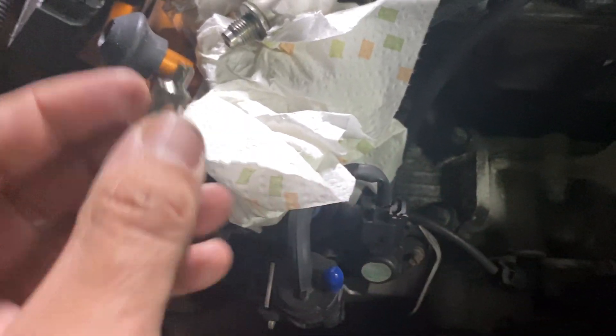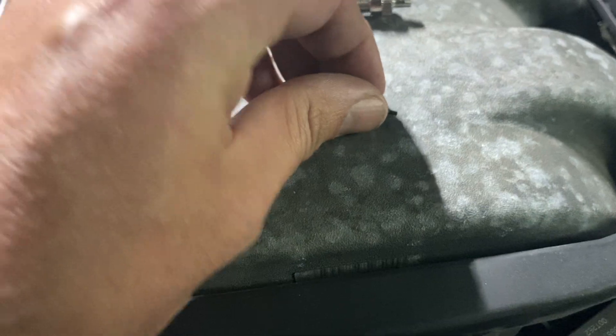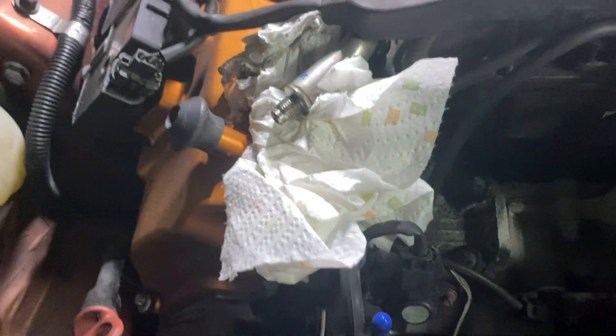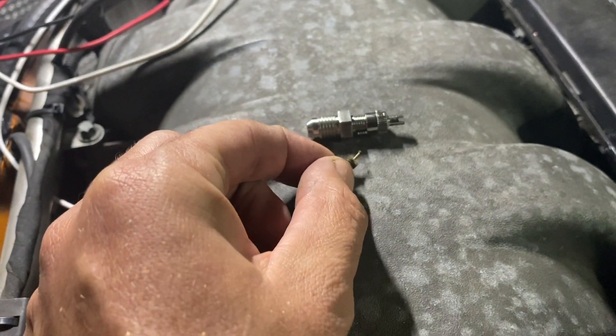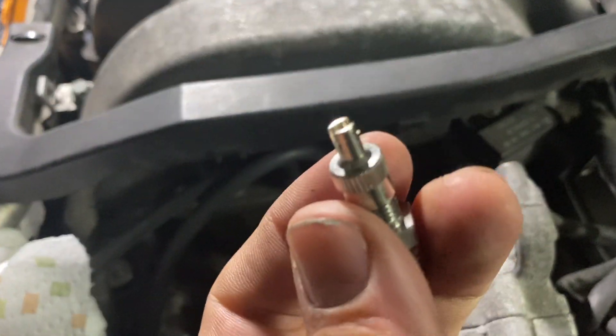Probably should've filmed this but no biggie — the Zex kit comes with this tiny little tool that's meant to take out Schrader valves. I put it on one of their fittings to give me a little more leverage. With the Mercedes fuel rail, you put it right in there and pull — what comes out is a Schrader valve for the fuel rail, just like a tire. You can use the same kind of tool, then hook your fuel line directly on it. Put some rags in there because fuel will most likely come out from the rail — just let it drip all out, and then you can throw your fuel line directly on that. If you ever don't want nitrous anymore, keep the Schrader valve — but they're pretty common to come by anyway.